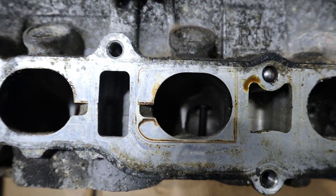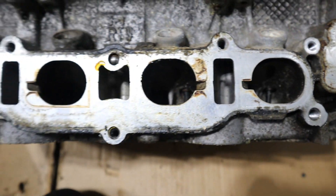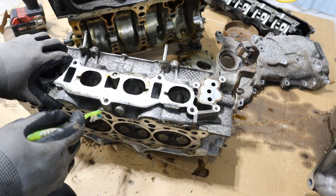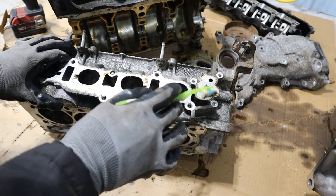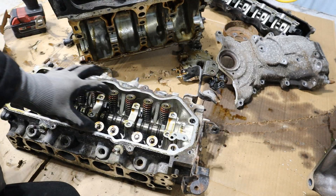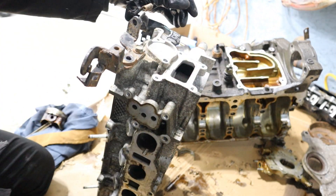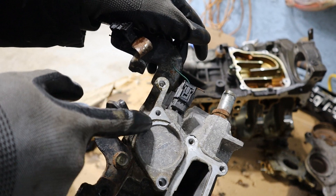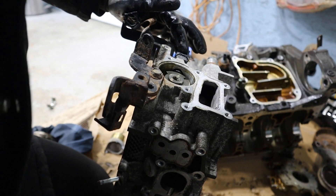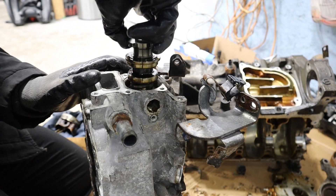Look at how clean those intake valves are — that's one of the benefits of having port injection; you can keep everything nice and clean and not have to open it up to clean it out periodically. Perhaps the most complicated thing on this engine is the VTEC system. Essentially oil feeds the head for lubrication and is channeled off to the VTEC solenoid, which brings oil up inside the rocker arm assembly. Removing this end cap, here is the camshaft. The cam sensor is located at the top here.